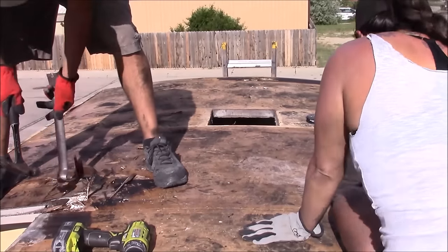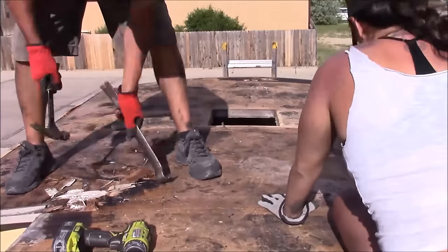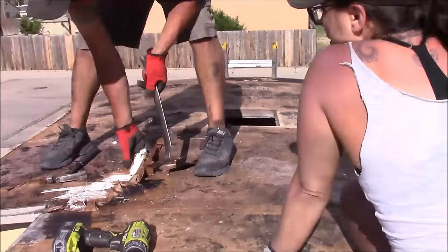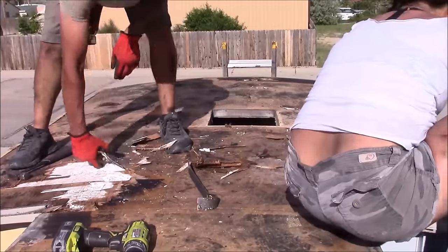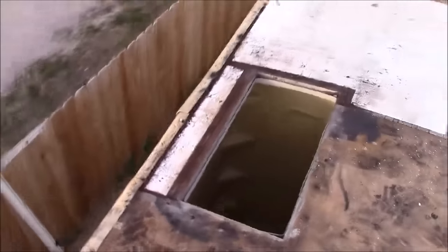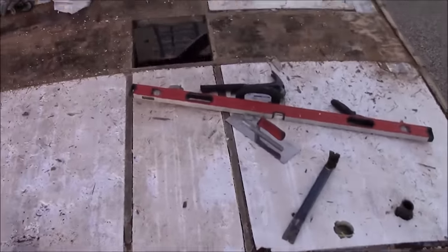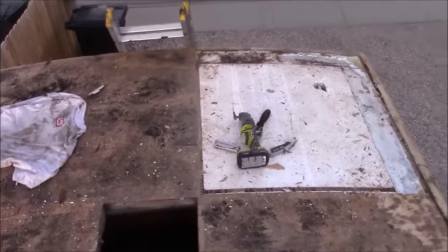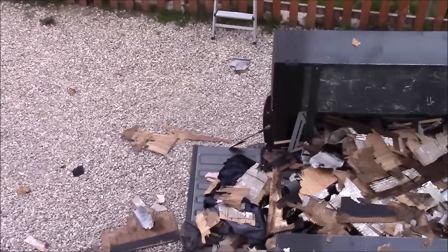To remove the old wood it's no easy task — it's all glued straight down to the styrofoam so it comes up in small pieces. I tried using a pry bar at first but I ended up damaging the styrofoam. But when using a putty knife I could stay in between the wood and styrofoam and not damage it. After getting all the wood removed, I need to clean the surface really well for good adhesion. I found that using a wire brush on the top of the styrofoam preps the surface pretty well — just be careful not to take off too much.